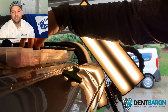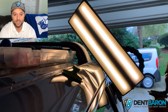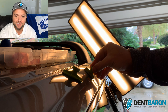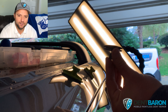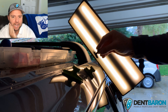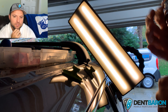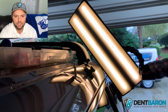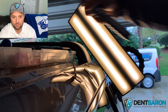If you guys like doing rails, let me know in the comments — maybe we can tag team: you do the rails and I'll do the top panels. I'm trying this old tab I got maybe four to six years ago on the shallower dent near the top edge. It doesn't pull as hard as some of them, and I didn't want a really hard pull. As you can tell, if they're not moving I really need to remove some of those crowns — the one right in front of you really needs to get knocked down right now.